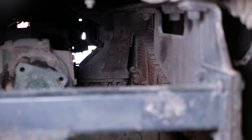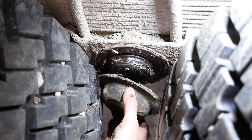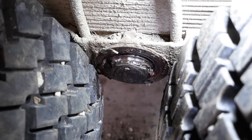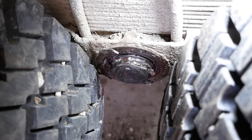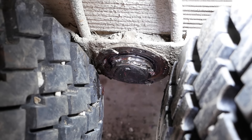I'm gonna wiggle the spring a little bit side to side. Watch that trunnion. You see that movement? I don't think that should be there. This trunnion bearing has a cover — I popped that off. Inside it looks to me like it's just a pair of tapered roller bearings, just like a wheel bearing set. You see that play? I think that's a problem. I don't know if it's all of the problem.